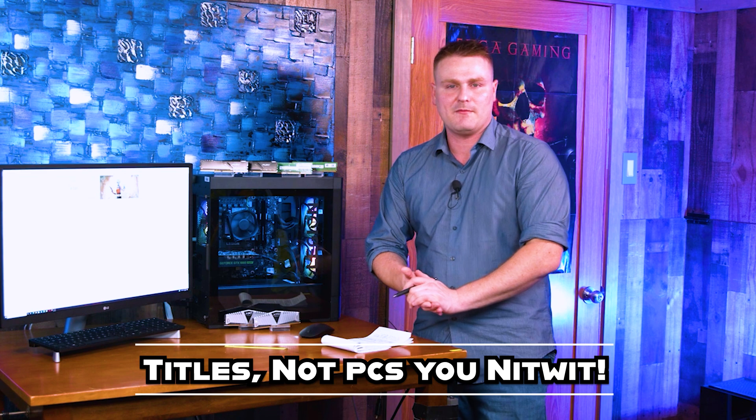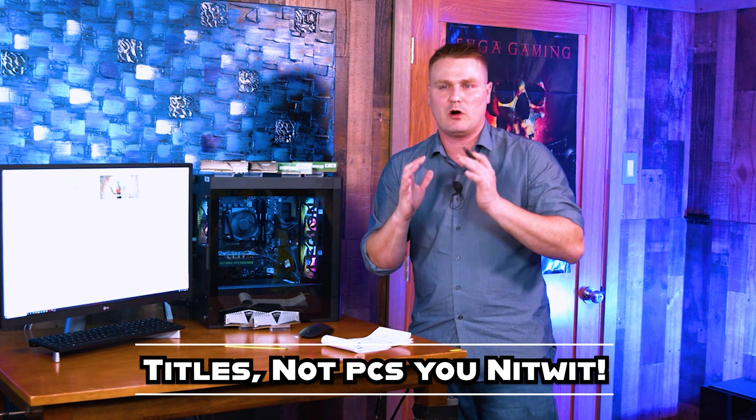As soon as we went up in capacity, we really didn't see anything past 16. So the sweet spot for gaming is going to be 16 gigabytes for this PC. Now if you're running MMOs or any type of use that requires more RAM, you're probably going to want to run 32. If you're streaming, video editing, or CAD, 32 gigabytes is going to be that starting spot.